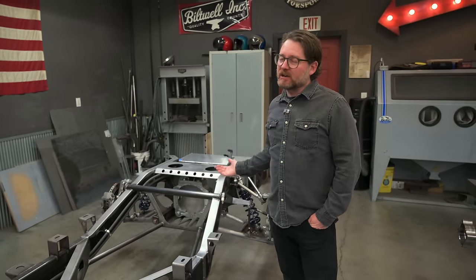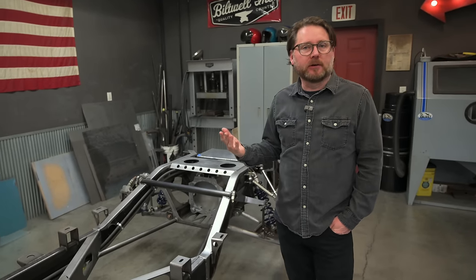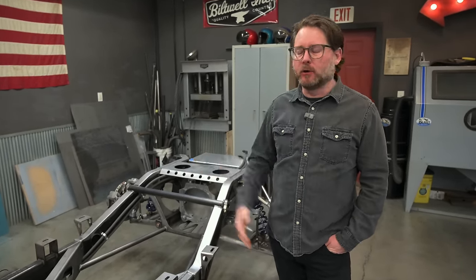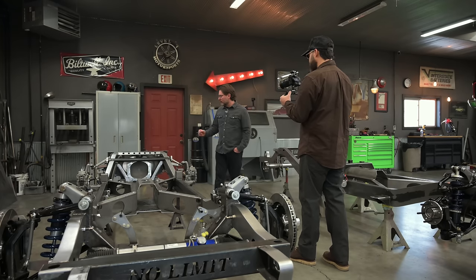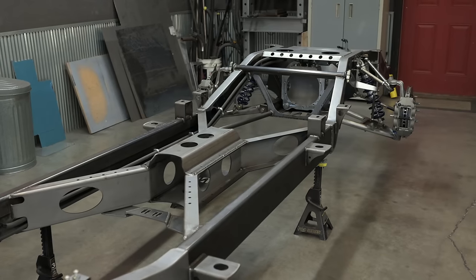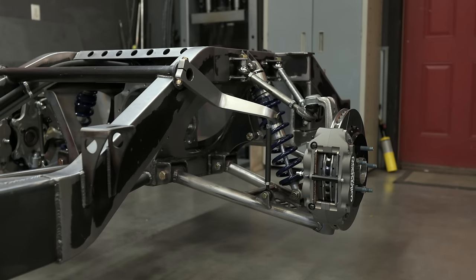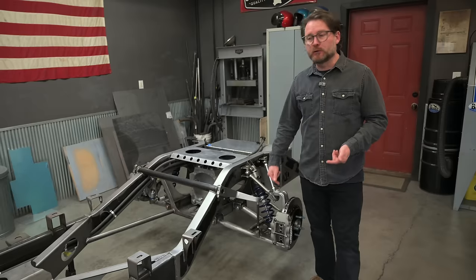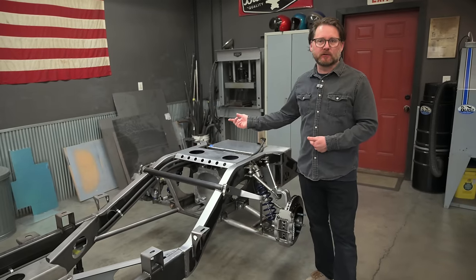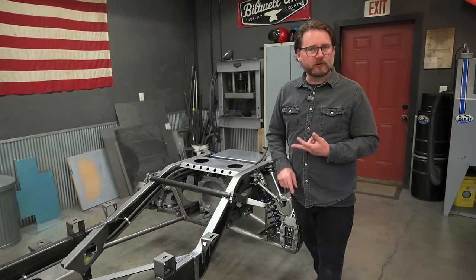All those trucks you see that are pretty hammered on the ground — those are what we call raised rail chassis. They actually allow the bottom of the rail to go like three and a half inches off the ground if you want it to. The new owner wanted the truck to go much lower, got a different set of wheels, and while we're at it, why not do independent rear suspension? With a thousand horsepower, there's an opportunity to get more forward bite and traction. No Limit uses a C6 rear spindle, which gives you the opportunity to use either a C6 or C7 unit bearing, so you can get independent wheel speed sensors and do traction control or ABS.